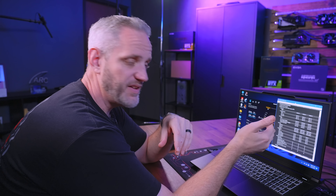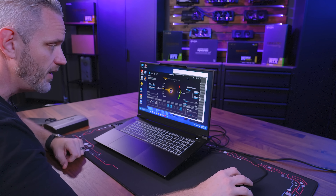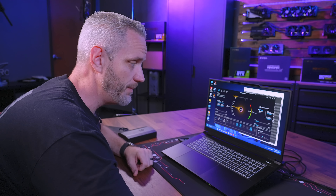If the memory temps are getting too hot, I've got to go back into my drawer of thermal pads and try to find one that fits without lifting the cooler off the GPU die — which is what I was experiencing the first time I tried thermal pads. With all that explanation said, I'm going to turn on the fans to 100%, load it up with Speedway looping like we did before, and see if those temps get out of control.